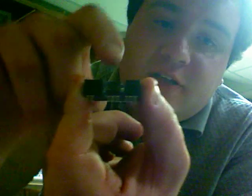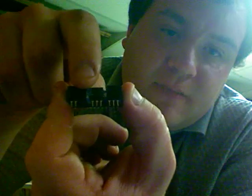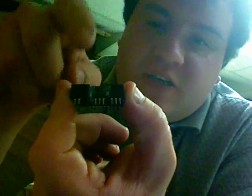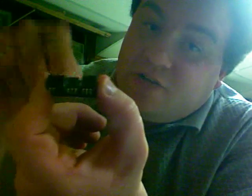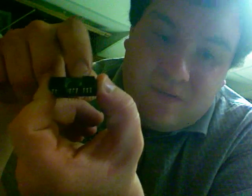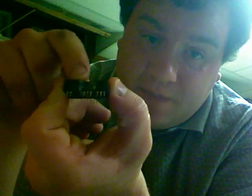When you have your module's positive and negative terminals exposed, take a voltmeter and touch the metal that you have exposed to make sure that you've gotten the battery disconnected. If you've gotten the battery disconnected, you should read exactly zero volts. If you didn't, keep trying until you get it disconnected. It's very important not to skip this step.